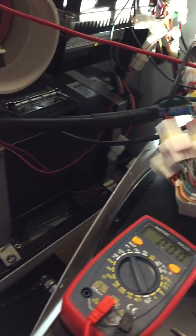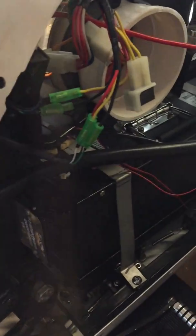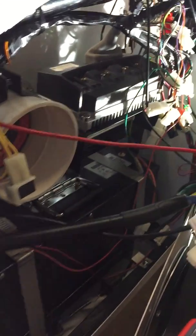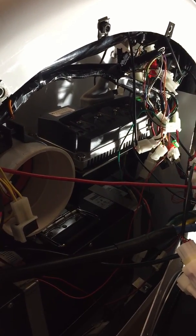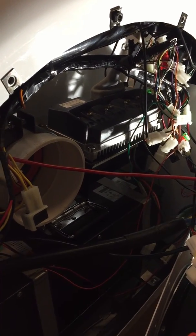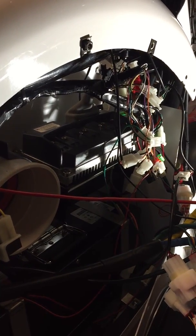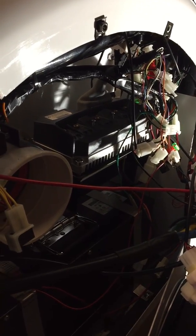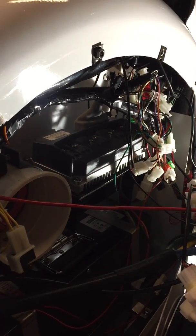I also had to reroute the faceplate sensor hole — the wire is much more rigid and thicker to manipulate. There are a lot of wiring differences too. I was able to connect everything to the original controller and got it running, but the original controller cannot handle the 3,000 watt motor — it's rated for 1,500 to 2,000 watt — so it doesn't function properly and just dies in the middle of acceleration.